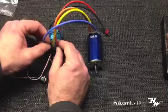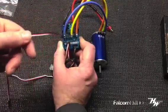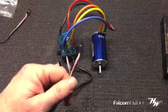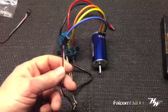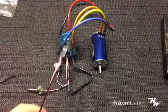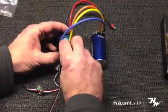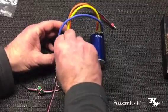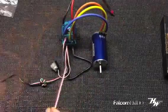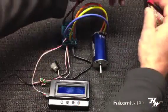Now I want to talk about programming. Your fan wire unplugs and you use your patch cable to attach the program box to make changes. That's a nice idea because when your ESC wire is attached to your receiver, you don't have to open everything up — you can leave it installed and go through the fan wire port. I've unplugged the fan and I'm attaching my program box wire and connecting it to the side of the program box, then plugging in a battery.